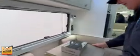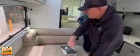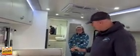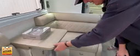Now, your table. A couple of tips with this table. If I pull it out, you can see that these two surfaces fold back against each other. I would put a bit of matting here, maybe a bit of that non-slip matting you put in your drawers. That will protect these two surfaces when they rub, and it'll stay looking brand new for the rest of the serviceable life of the van. Now, if I fold this back, you'll also see that this leg post here can touch a bit against there. I've seen people cut the bottom out of old stubby holders and slide it up, and that will protect the cabinetry and the leg as well. It's optional, but you can do that.